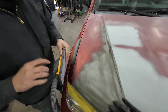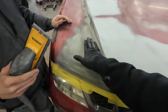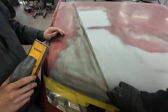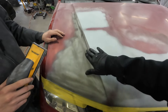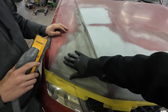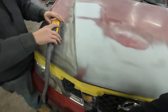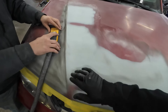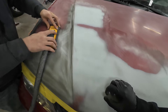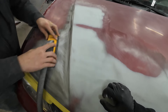This is going to be a little bit more challenging because we've got contours here, but we also have a little contour into this area right here. So we use a different block for this groove. Don't try and block it with the larger block — we'll block the flat area with that and then get a smaller block to block this section where it rolls over. You can go up to this edge, but you don't want to try and get in that contour unless you really have some experience blocking.